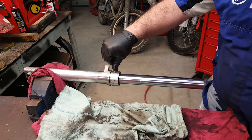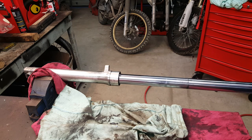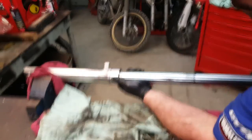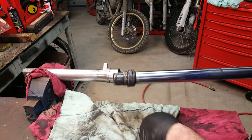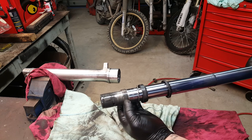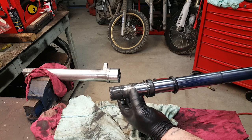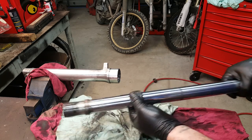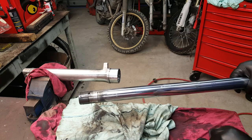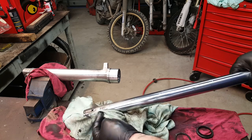Other than lots more oil, there's nothing inside the fork now. We're going to stick that in the vise and I'm going to show you how to separate the two parts and bring out the seal at the same time. We've still got the dust seal, the main seal, and the bush all inside the lower fork leg. To remove them, all we have to do is pull out the stanchion as far as it will go and then use it a bit like a slide hammer. There we go — it's out. We've got the dust seal, the main hydraulic seal which is in a very bad state, a washer, and the top bush. And that there is the bottom bush — we can't replace that, we can't get those anymore. The order they come off: dust seal, main seal, washer, and then furthest down is the actual bush itself.